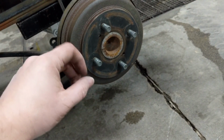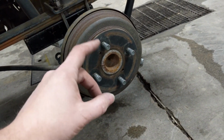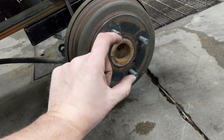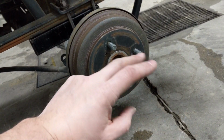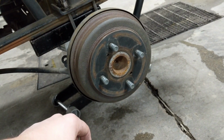When you go to the Imperial system, this is not exactly 4 inches center stud to center stud. It literally burns my bird. There have been so many guys selling 4 on 4 wheel spacers, 4 on 4 wheel kits, things like that. You can put it on there and stretch your studs to fit, but it's a pain. So if you're doing anything with your mini truck, whether it be wheels, tracks, spacers, or adapters, 4-on-100 is the only way you can go, plain and simple.